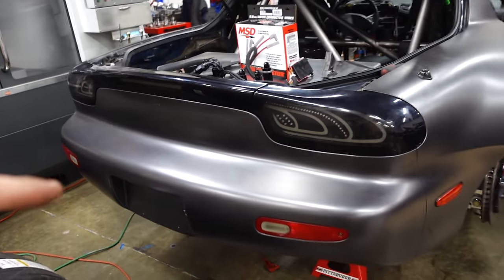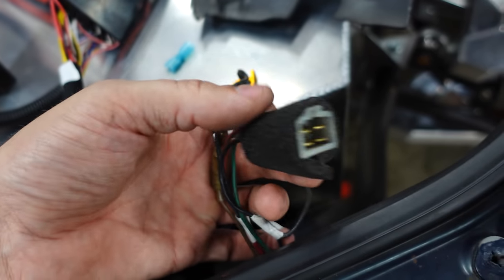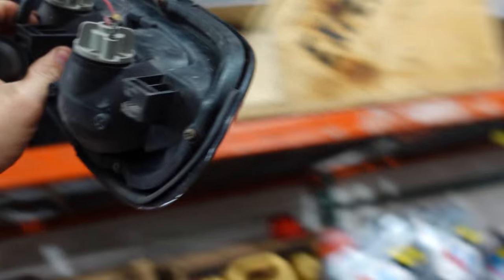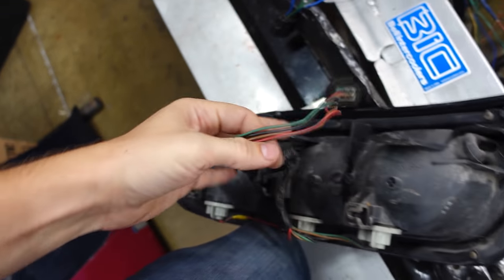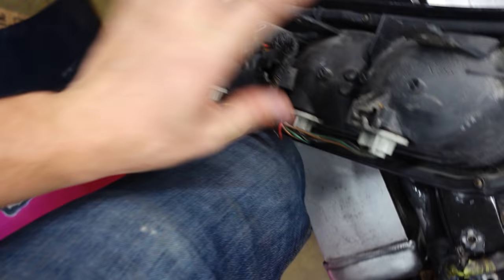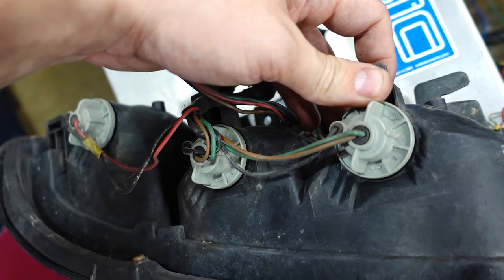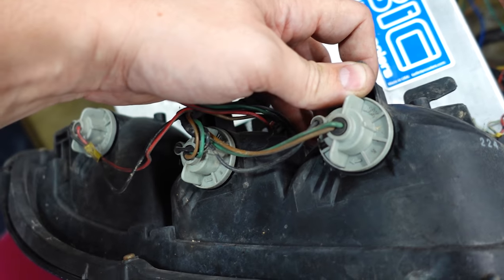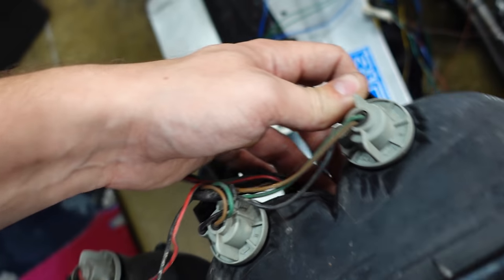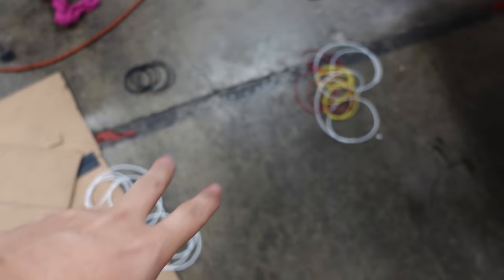There are two parts to the wiring: one is the stock FD wiring harness. It's actually four spades. Here is a stock brake light — there are three lights to it. Long story short, you can see these middle two have ground green and brown. The ground is obviously black, and green and brown are running and brake lights. Over here, ground and red is your turn signal.